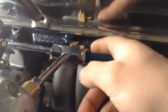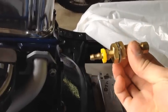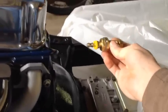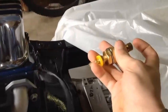I'm going to run a rubber fuel line up to here — it'll just go straight up, along here, and that's going to go to the cab. I wanted to run metal line the entire way and just put a grommet on the cab with metal line, but with the amount of movement I thought that might not be a good idea because it could cause some issues. So we're going to use rubber line to the cab. What we're going to do is drill a half-inch hole in the cab, slide this in, and bolt it in place. Then we'd run a rubber hose from this along the line down into here, and then metal line from there to the gauge somewhere in the dash.